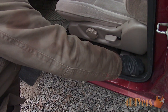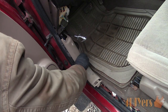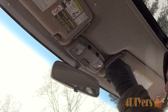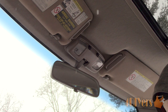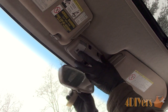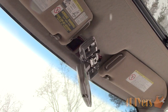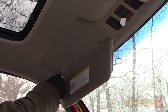To run the backup camera wire I also needed access under the carpet. Remove the four Phillips screws then pull up the trim along the rocker. Next is removing the kick panel — grab onto the bottom and pull back. On the previous install for the Ford Ranger I used the supplied clip for the hands-free microphone to clip it onto the sun visor, but this clip doesn't open wide enough for the Tacoma sun visor and the headliner doesn't allow for the wire to be easily hidden. So instead I'll do something a little different. Removing the map light — using a small standard screwdriver pop up the center trim cap, then using a nylon trim tool unclip the cover prying at the base. Remove the four Phillips screws holding on the map light base — don't mix up the screws as there are two different types. Then disconnect the wire plug on the rear, depress the tab and pull out. I'm dropping the headliner down slightly so I can run the microphone wire.